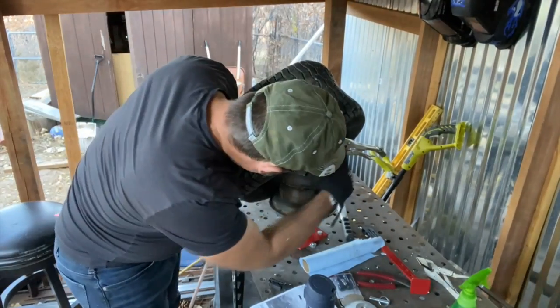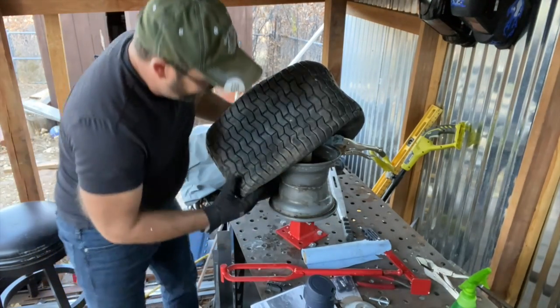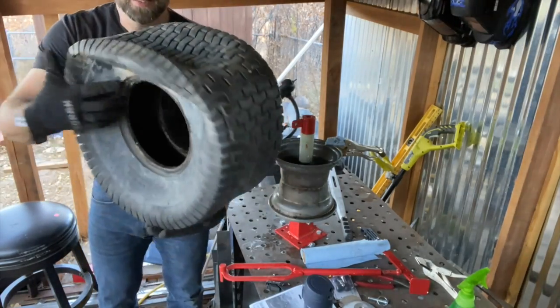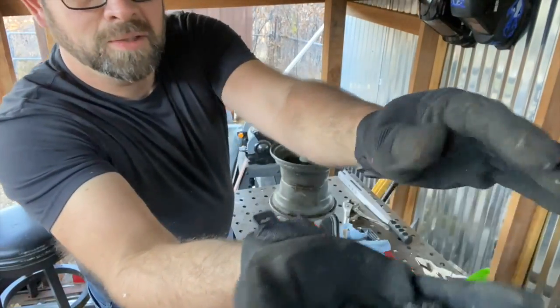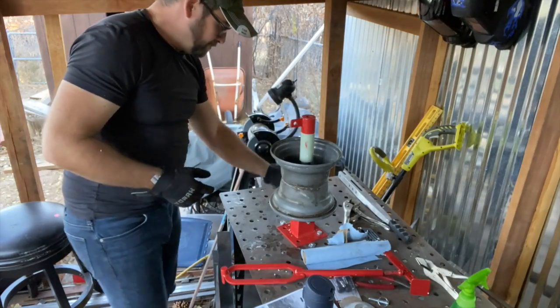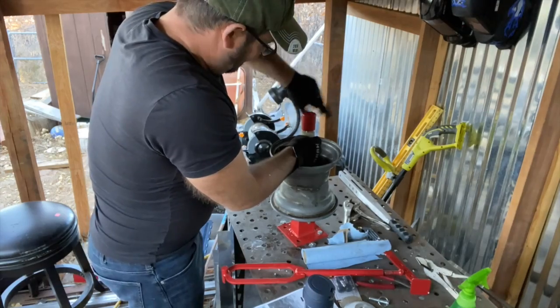Okay, the vice grip method did work. The thing you have to do, make sure this bottom is up higher on the lip. There we go. It's really hard with this tire being so darn deformed and so messed up. So I just cut the valve stem out with my knife, just slice across the back. I'm gonna put in some new ones. Hopefully use our cool little tool.